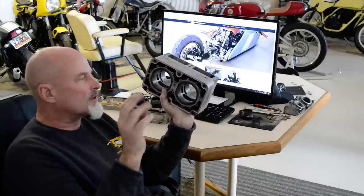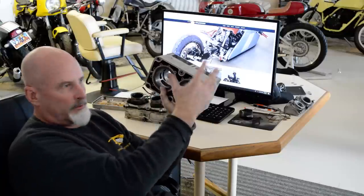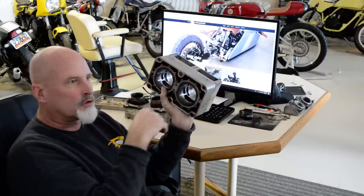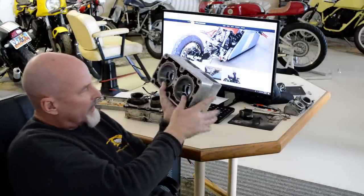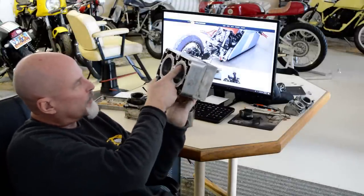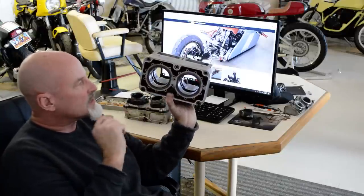Ultimately, luckily I've never had to do it. I press them in, bore them on my fixture — so they're all torqued correctly — and they come out really nice and round. If you look at the wear pattern, it wears just perfect all the way around. It really works very, very slick.